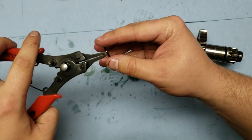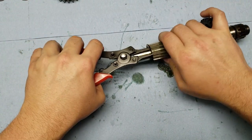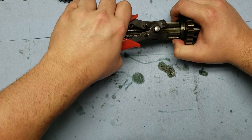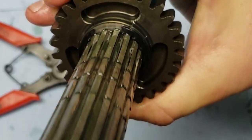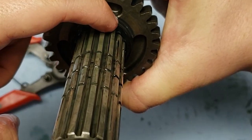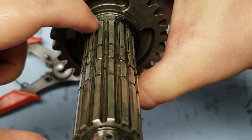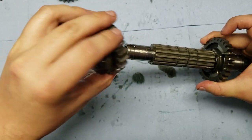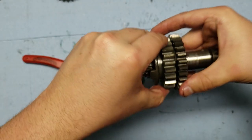With the sharp edge facing outwards, I'm going to go ahead and use my snap ring pliers. It can be a little difficult whenever that reverse gear is wanting to move on there, but I'm going to go ahead and close this off and try to get that set all the way down in there. That's about as close as I can get it with the ends sitting on the inside of the splines — the manual states it wants the ends of the circlip actually in the splines. Next up we have the second wheel gear, and these tabs here are going to be sitting inside of this gear, so I'm going to go ahead and slide that on. Fits in there nice.